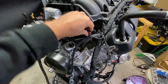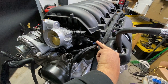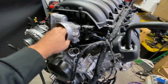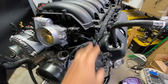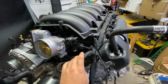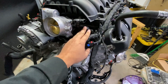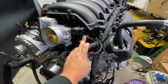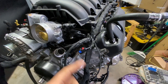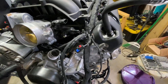This is part of your emissions — this is your purge valve. This is how it basically allows your fuel tank to breathe by releasing the vapors, the gas, from inside your engine, keeping it all contained so you're not having fumes outside your car. This is all internally regulated. A lot of guys ask me where the connector for this is — I delete this because 99% of builds aren't running full emissions. The only reason you run this is if you're doing an evaporative system, which is not just this valve. It's your fuel tank, your fuel cap, your vent valve, your fuel tank pressure sensor, and your charcoal canister — this is a whole system that's involved. So this usually gets deleted.